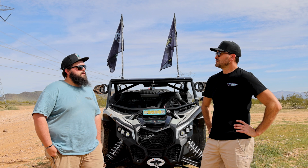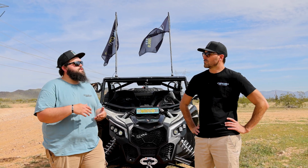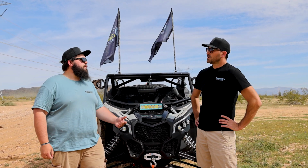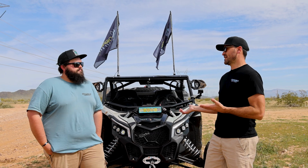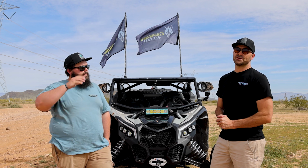Yeah, it doesn't seem like it's beating you up as much. It doesn't feel like it's as harsh. Like you don't feel it in your back as much is the easiest way I can explain it. Like a lot of these bigger G-outs, stuff like that, you don't feel it as harsh on your body as much as before. And as good as stock valving is, that's always going to be the downside. A real professionally valved car is going to have that suppleness. They know how to make that magic work in the valving.